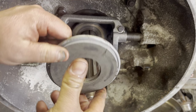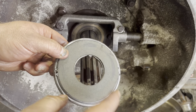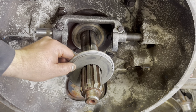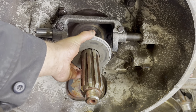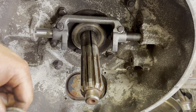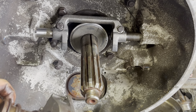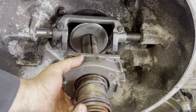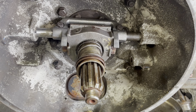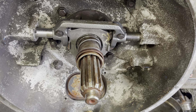You've got your two-inch brake here — this is your clutch brake. If you look down the shaft you'll see that there is a spline cut out. If you look at your brake you see that you have these two little nipples that stick out — slides right on just like that. That keys the clutch brake to the shaft. You can see where your clutch brake hits up against the input shaft cover. Now we've got this old throwout bearing from a clutch — we took it apart to give you a visual demonstration. This throwout bearing does two things.